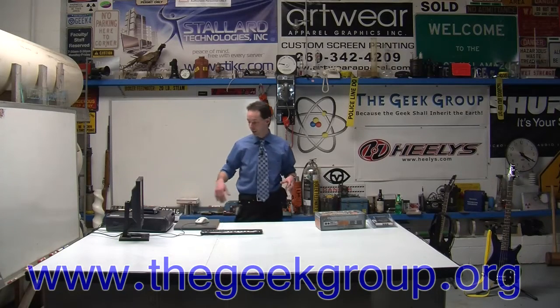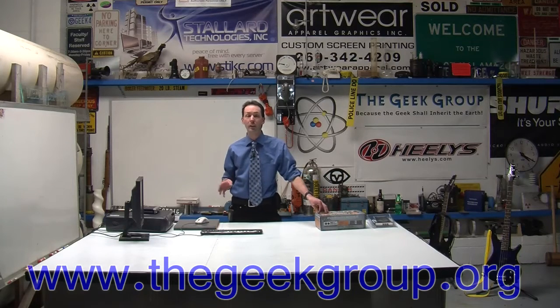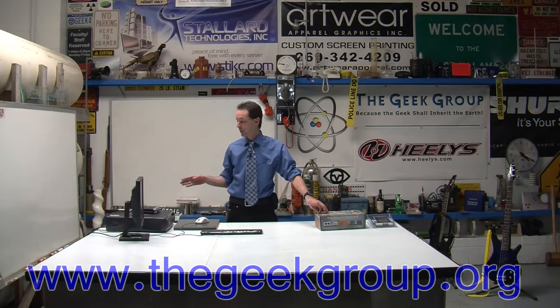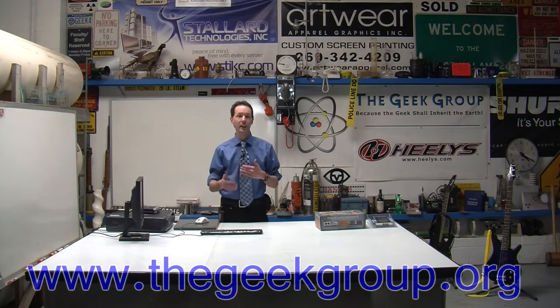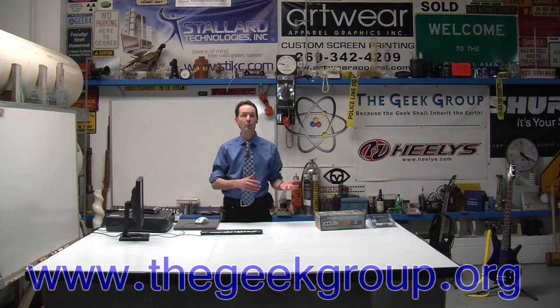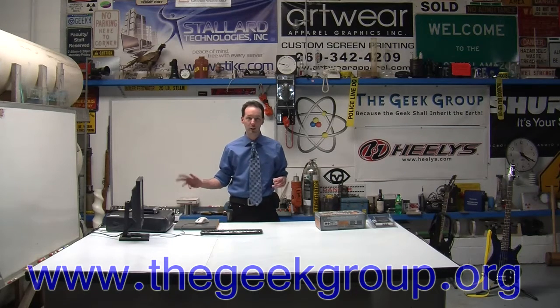The Lexicon Alpha seems to be like the black sheep of the Lexicon family. Lexicon makes some really good stuff — we use a lot of their gear — but this particular box is eh. What it is is basically a really high-end sound card. It puts audio into and out of the computer in a lot of different formats through USB. By doing it through USB, there's a huge amount of delay — like 70 milliseconds or so. It's huge.